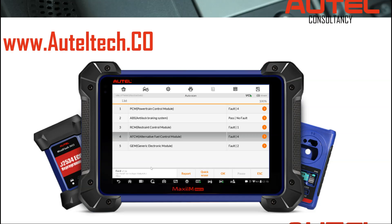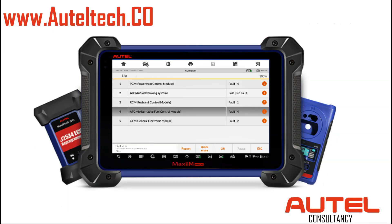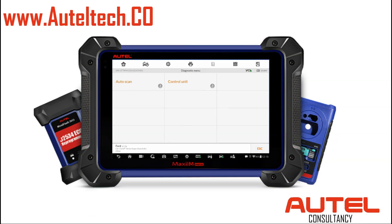So I went into his tablet. The first thing I always do is an initial auto scan, just in case there's something that my engineers see — I can submit a data log. Then from there, I clicked Programming and then went to Programmable Module Installation. Programmable Module Installation is basically a sequence where it extracts all the original ECU's information and then prompts you when to put on the replacement module and transfer the information over. Normally the Autel has this feature for the PCM, but for this vehicle, it's not there.